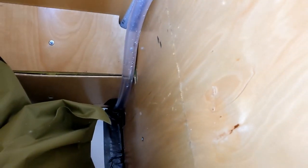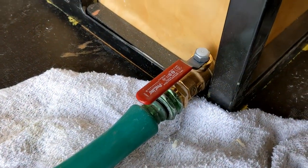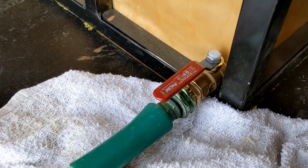The greywater tank fill pipe is right in the center of the screen — it goes under that piece of tape, and there's a T where you can see the bladder pulling on it. The pipe continues out the back. To drain this, you come out the back — there's a hose fitting, a ball valve, and a safety cap so nothing leaks going down the road. Part of the idea of this van was to keep everything inside so we can use it in the wintertime — we hope to use it as a ski vehicle. Basically, you just get the bladders kind of straightened out in here.